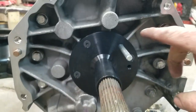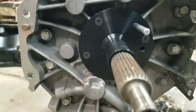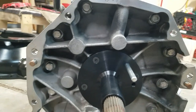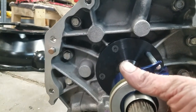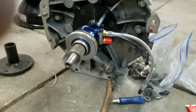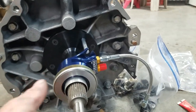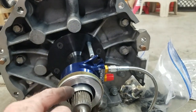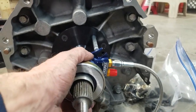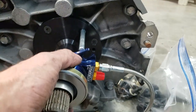They also suggest putting this retainer stud at a 2 o'clock position, so when you slide this on, it's holding it like that. See, like so. I'm not sliding it all the way on yet. There's an O-ring in here I got to lube up before I try to slide it over the bearing cover sleeve.